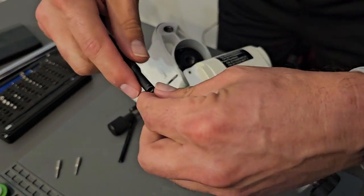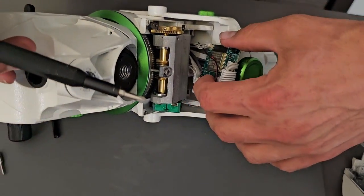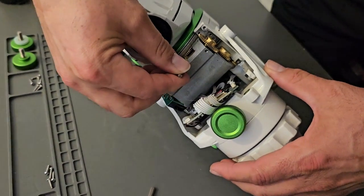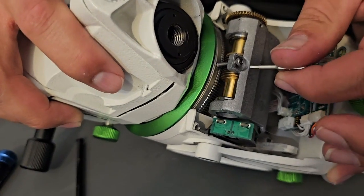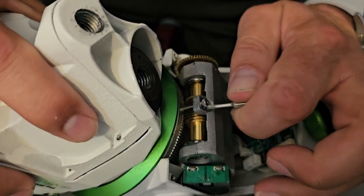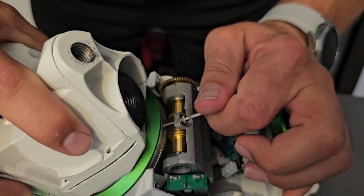Using my Phillips — easy peasy. The screws have kind of remained in their holes so I'll leave them there. Now let's get our allen — that is two millimeter — and look at that, it is like finger loose at the moment. So we're going to tighten up and try to get rid of that backlash and side-to-side play. We don't want to over-tighten it, so I'm going to back it off a little bit until I have just a little bit of slop, and then as I'm flexing it back and forth we'll slowly tighten it up.